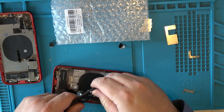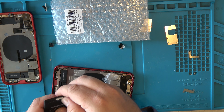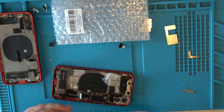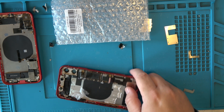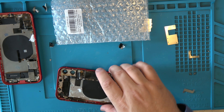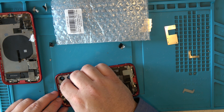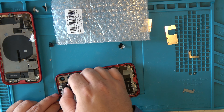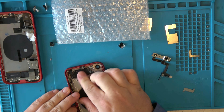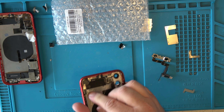Now that the battery is out, I cleaned it off while it's hot. We can start taking out the front camera and Face ID components, set them to the side, and carefully remove the glue. Now we can remove the motherboard — using a plastic tool where fingernails won't reach. Check your orientation. The motherboard should come up, and it does.